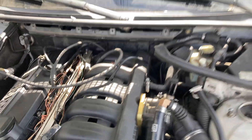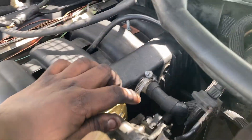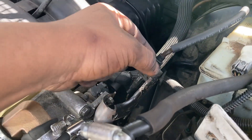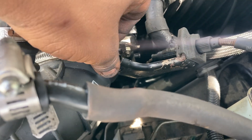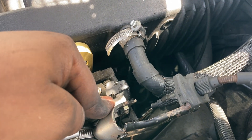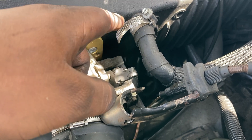The hardest part I've faced with this whole thing was the throttle cable — not even the throttle body itself, but the throttle cable. What we did — this is only temporary — we cut up and bent up the old one and put it on here where the throttle body positioning sensor is. This is the screw for it.